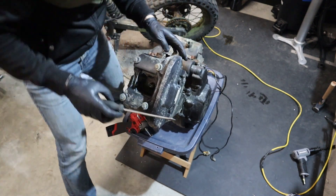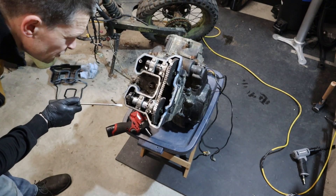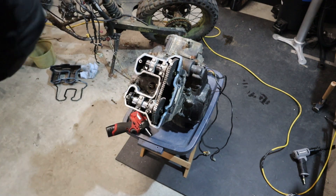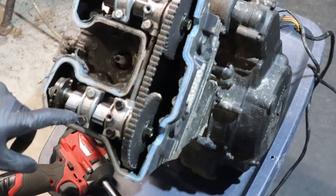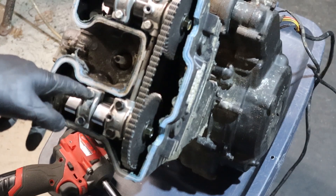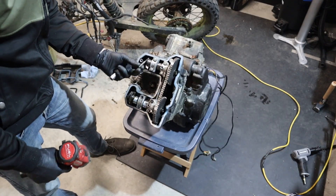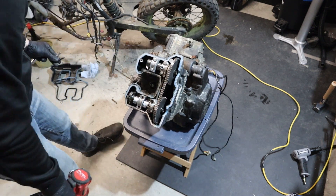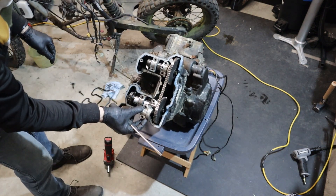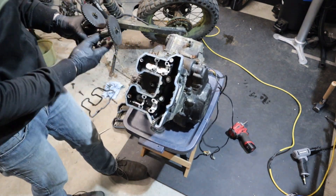Lots of silicone holding this valve cover on - is that good or bad? It can't be good. What is under the valve cover, folks? There's your compression release for your decompression when you're starting it. If you look at these bolts, you can see - notice how that one is very OEM looking, with a built-in washer, versus aftermarket off the bolt bin from Canadian Tire or something. This thing's been apart before. Did they lose the bolts? It's like straight out of the bolt bin compared to that. Here's the compression release. Oil feed for the head.